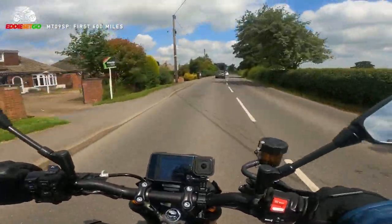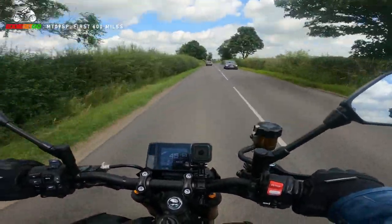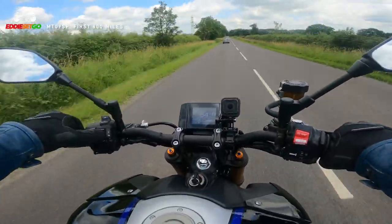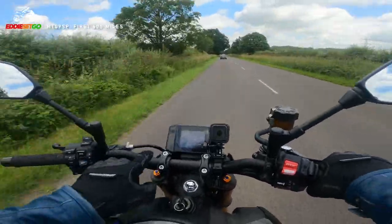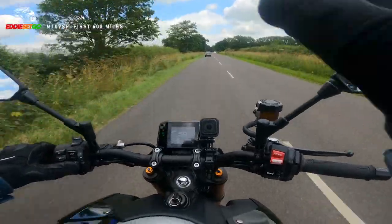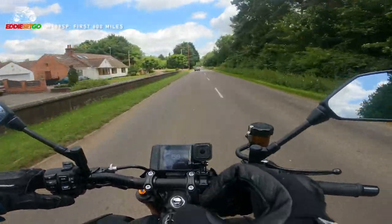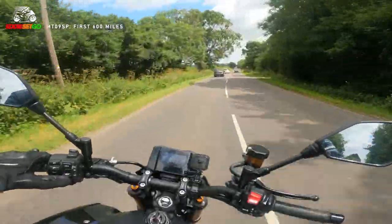The cruise control is something I didn't think would really matter or I wouldn't be too fussed about. It turns out the cruise control is the thing I use the most on this bike. It engages from fourth gear up to sixth gear. If you're going above about 20 miles an hour you can engage it - it's very simple using this selector on my thumb. You press the middle button which lights up the cruise control activation system, then all you do is press the set button, take your hand away, and you're off. What I find is after doing some hard riding in corners and gripping onto the accelerator, your hand can get quite fatigued, and after those really twisty intense sections I can slap on the cruise control and give my right hand a rest.